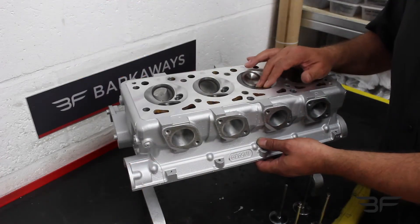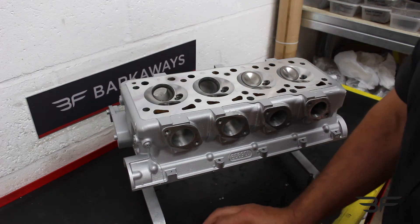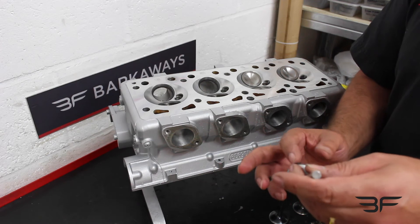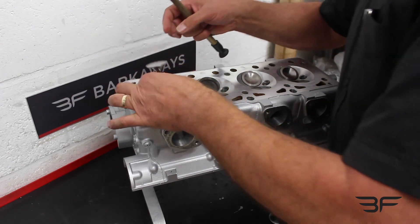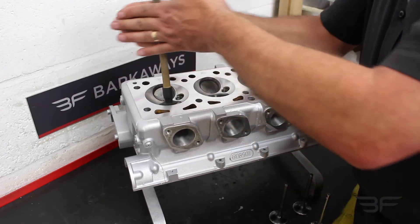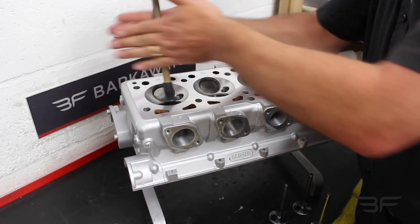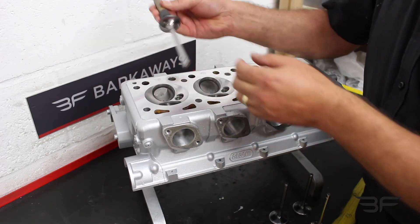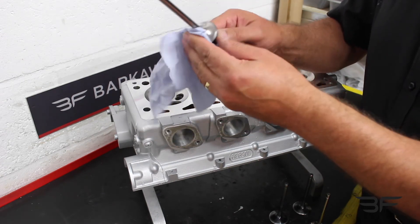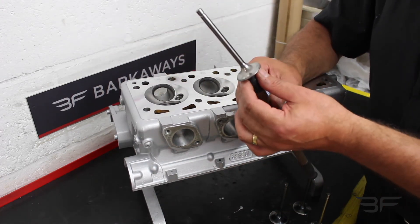I'm just going to show you how we do that. What we need is for the valve to shut absolutely perfectly every time the cam closes it. So what we do is use a very fine paste and put a little bit around the bottom of the seat, put it into the tool and just literally finish it by hand — you can just hear it bedding in. That cuts the two surfaces, the one on the valve and the one on the valve seat, perfectly matching them as a pair. A couple of goes of that will match those two seats perfectly and then it will seal as we need it to.